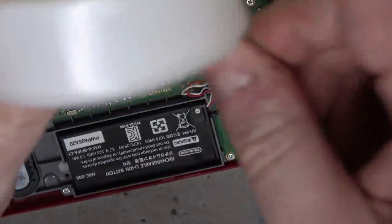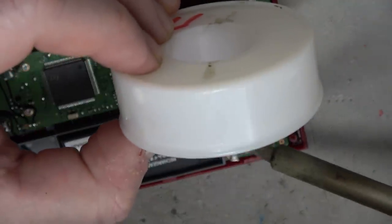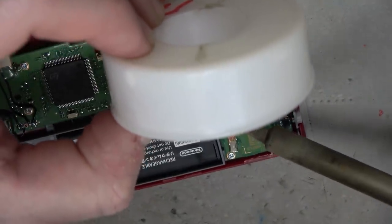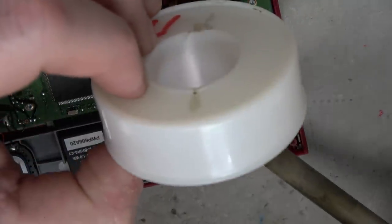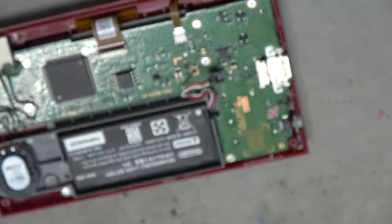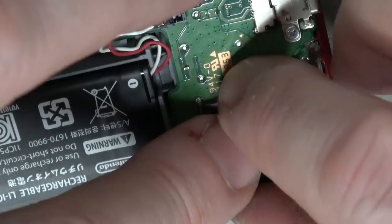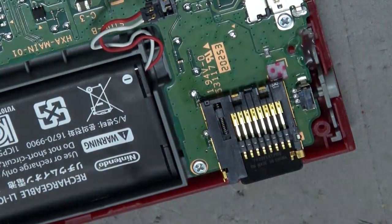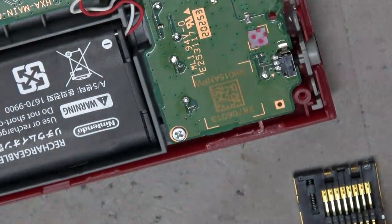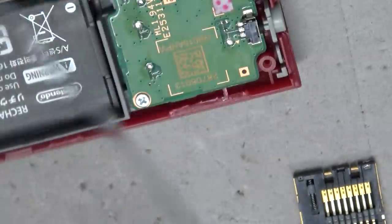It's a couple of solder blob test points near that. I'm actually going to hit those with my solder wick to flatten them out. Because if you remember that cheap Menards watch I was talking about, if I went in and actually solder blobbed the test points, it probably would keep me from folding it all back together. Just the other day, cut like a piece of plastic. Ah, it's kind of thick though. Yeah, it should be all right.